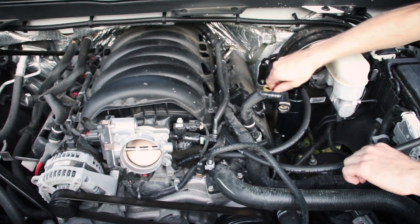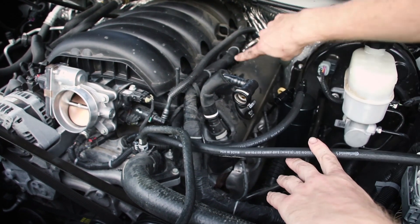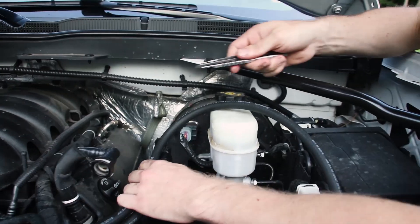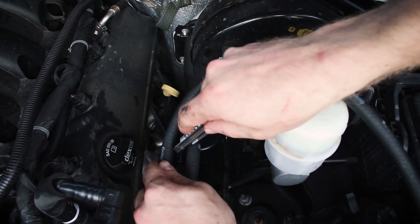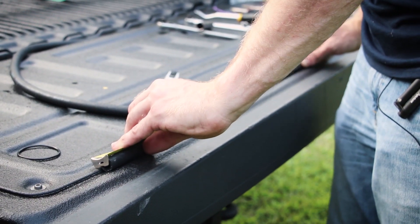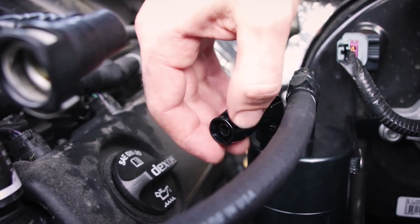We could have gone straight from here down into the PCV fitting, but that makes it inconvenient to access your oil fill cap. So I'm routing it along that trench in line with this right up into there, and zip tying the two lines together so it'll be nice and clean. Mark where to cut — you want it about halfway up the fitting. Always leave a little extra rather than cutting it too short. This second hose is 23 and a half inches. So the shorter inlet hose is 19 and a half, and the outlet hose is 23 and a half. Go ahead and unscrew the AN fitting.